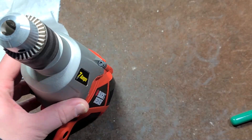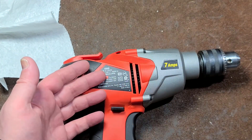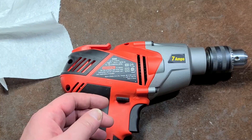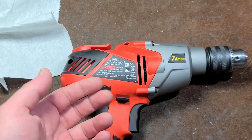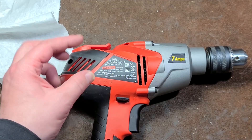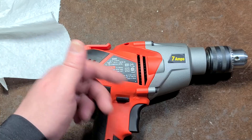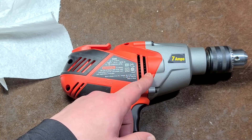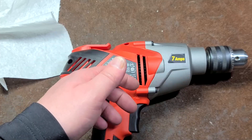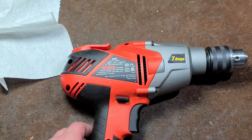It's definitely not going to be quite as torquey as the professional drills. What they tend to do is have a higher speed motor — the DeWalt DW-235G only has a 7.8 amp motor, but the motors spin thousands of RPM faster, which allows a lower gear ratio for the same output speed. Because of the faster motor, that reduced gear ratio means they deliver a lot more torque. It's cheaper to make a motor that spins slower.